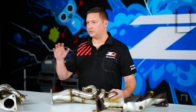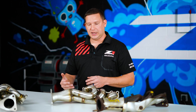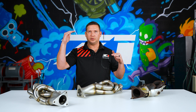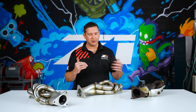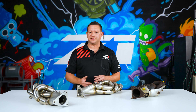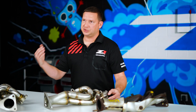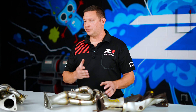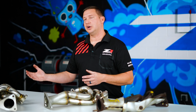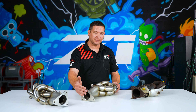Great in applications that are NA or forced induction. We're seeing oftentimes in the past we'd have vehicles come in with superchargers on wanting to make a header change from factory manifolds, and oftentimes we're seeing a big boost in efficiency where power normally, as soon as you do a swap, would drop because boost will drop as the engine can move more air. But you can usually make just small tweaks on the retune and get it cleaned back up so that it is making the same, or now we're seeing more power in instances at a lower boost level. So we're more efficient, we're running cooler on the VHR specifically — under hood and engine temps are a high thing to combat already. We've got to add radiators and oil coolers to these always when we're trying to track them or use the revs for extended periods of time, and if we can be more efficient on the engine as a pump as a whole, we're seeing that benefit really help us with long-term abuse where we're running cars non-stop on track.